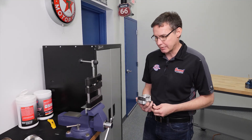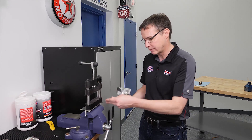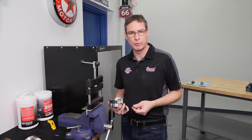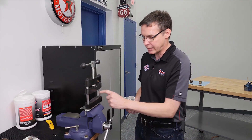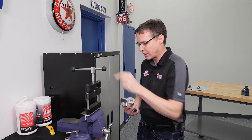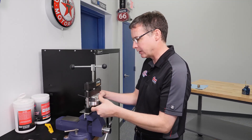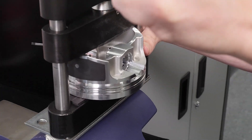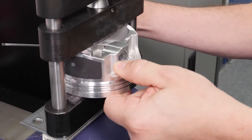Summit has a wide variety of tools, and in this case we have a really cool rod vise that bolts right into your main vise. We pull this out any time we're building an engine. This one is pretty cool because it's got a magnetic strip down here, which makes it easier to locate things. So, first thing we're going to do — this piston happens to be short enough that it fits in — we're going to load it in here and just lightly compress it. We don't want to distort the piston, we just want to make sure it's secure.